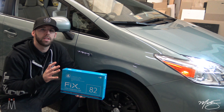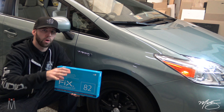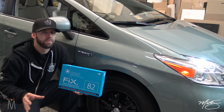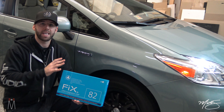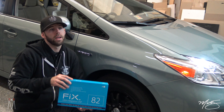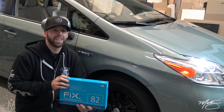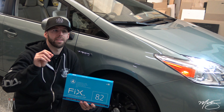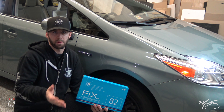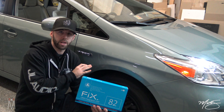What you need to know about these is they are digital sound processors that are going to fix the factory signal in your OEM radio. So if you're looking to upgrade the sound in your current car and it's difficult to replace the factory radio and you want to keep the factory items intact, a good solution is to use a fix. The reason you'd want to do this is because the EQ curve of your factory radio is accommodated to correct the appropriate signal to the factory speakers.